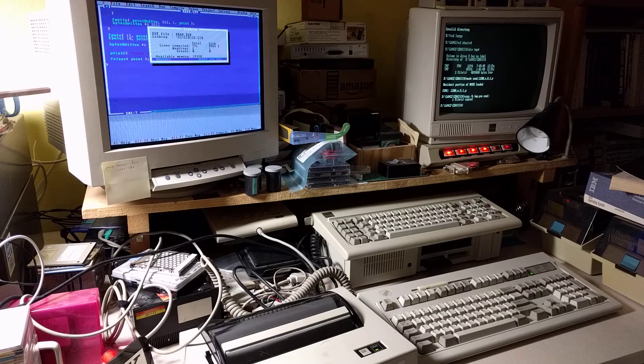What I've done is I've taken an old CompuServe RLE graphic and encoded it for this printer. It's taken me an hour to remember how to actually send it to the printer correctly. It's not a big trick, but it's a serial printer and you have to remember to use slash B for binary copy on the DOS command line.